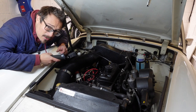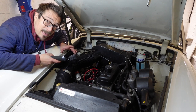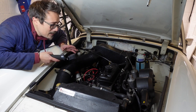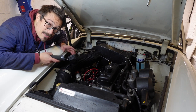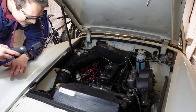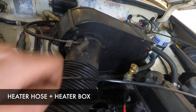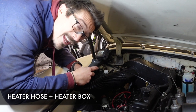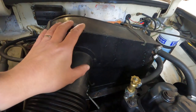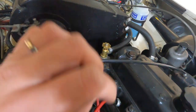This is going to be a brief overview. For more detailed information you'll need to consult the manuals or someone brainier than me. We're going to work clockwise, left to right. Starting here, this hose goes into that black box - that is the air intake into the heater matrix box. Cold air comes in, and this box is fed with warm water through hoses via an adjustable tap from the block.